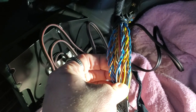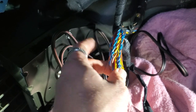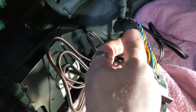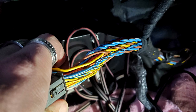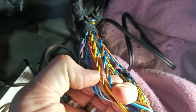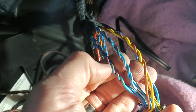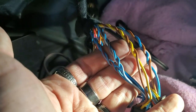Our factory amplifier is back here — here's our harness. That's going to show you exactly which speaker wires to match up from the fronts to what's on the backs. There are a lot of wires in here, so you want to make sure the braided speaker wires have matching colors to what you used in the front. Always keep track of your color codes when you take speakers out, otherwise it's really hard to figure out which wire goes to what. The thicker wires are your two rears — yellow with brown and brown with blue. Fronts are white with blue, blue with brown, blue with red, and blue with brown. Those are your main wires for running a component or coaxial set.